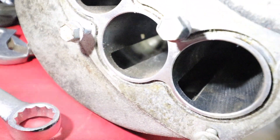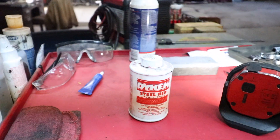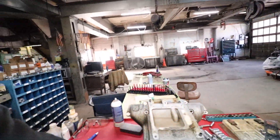I'm just gonna touch it up, get it a little bigger, and smooth out all the ribs in there. You can see the lip here and how it has this big ledge — I'm gonna smooth that out. I need to clean this intake out first, especially after taking these cores out. I got quite a bit of coolant in the manifold itself. If you guys have ever taken the Ecotec cores out, you know what I'm talking about — there's a lot of fluid that gets caught up in the intake. I need to clean that out and dry it so that when I'm cutting and sanding, the debris doesn't turn into mud.